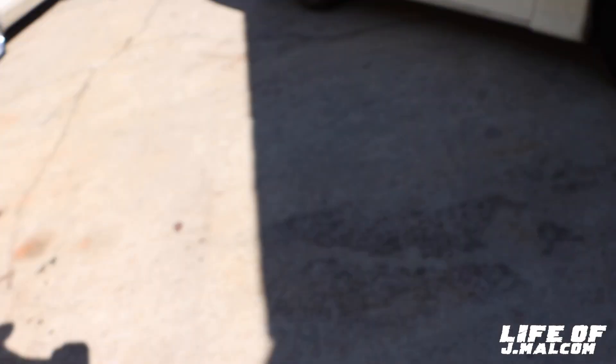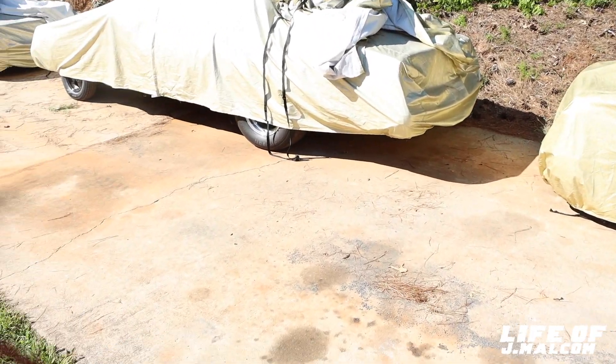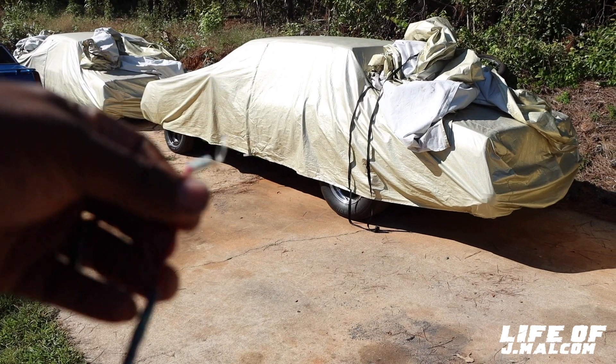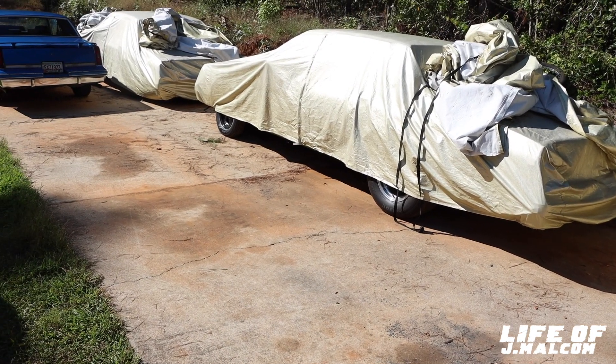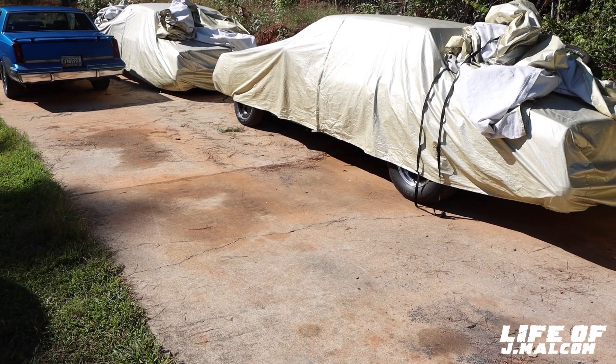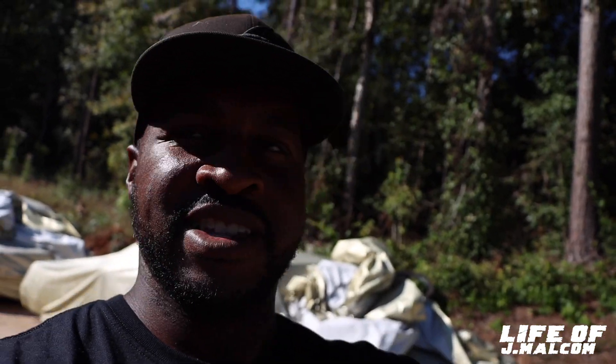Let me show y'all what the problem was. I dropped the wire over here, man. When I saw it, I was like, man, I could've — I ain't even had to run the whole wire. When I took the wire loose from the battery, check this out — y'all see that sticking out right there. The wire slid out the insulation. That's just empty insulation. The wire had slid out. I mean, it was burnt — it was burnt on the header and stuff, y'all saw that in the other video. That wire was crispy. So I had to cut it loose. But the connection also had came loose right here. So it was just an empty end on there — it wasn't getting fired from the battery. Either way, I need to run a new wire. That's it. That's gonna get it for today, y'all. I'll catch y'all later. BCG, we out.